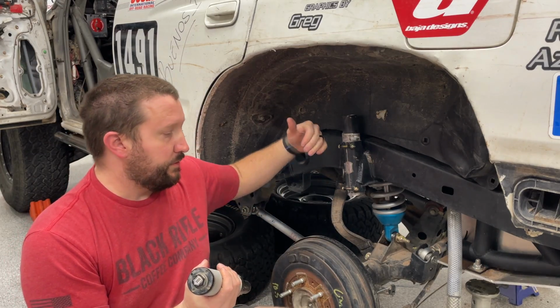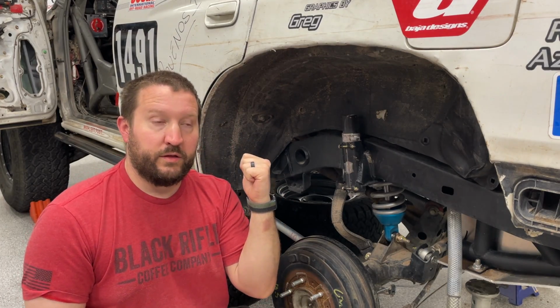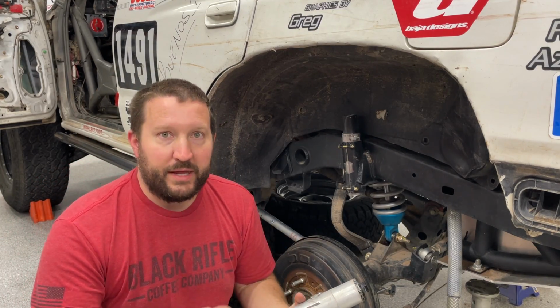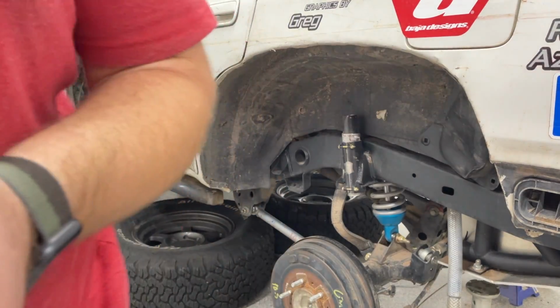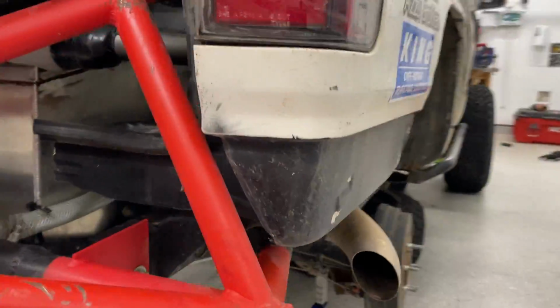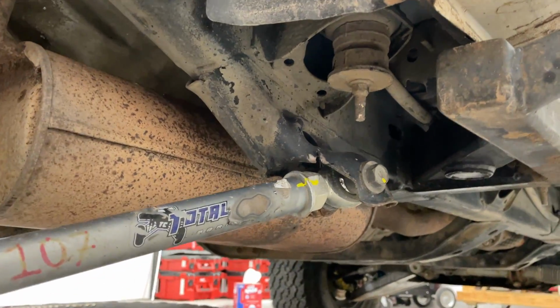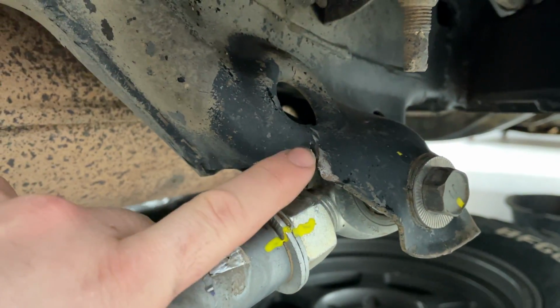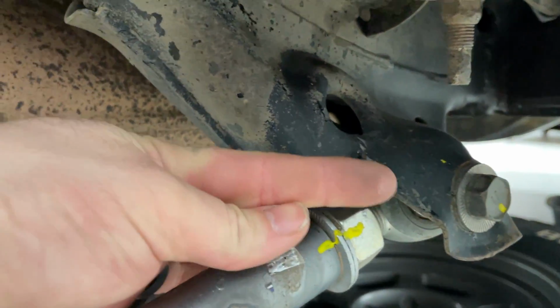The suspension mount on the other side collapsed forward, as in it was pushed this way. The control arm did the pushing. It wasn't squished by a rock. It wasn't twisted by hitting an obstacle itself. It was physically metal pushing through it, and that made that mount bend. So, right here, see how that has been pushed very hard to the right? Well, this crack, this tear on the outside is indicative of this getting forced this way very, very hard.